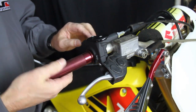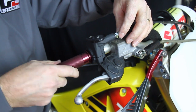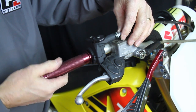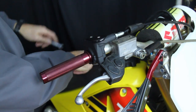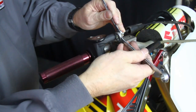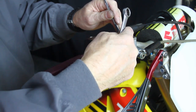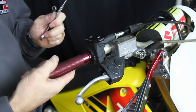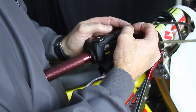Now we need to adjust the slack in our throttle — there's too much free play, so we turn the cable adjuster out until we get the desired free play, always making sure everything snaps back. Once I have the desired free play, I hold the adjuster and turn the jam nut in. Using an eight millimeter and a twelve, tighten the jam nut — it doesn't need to be very tight. We're dealing with a plastic insert and a steel threaded adjuster, so just to where things are snug, always making sure the throttle snaps back. Then slide the boot back over the top.